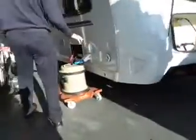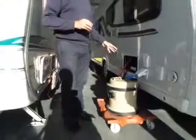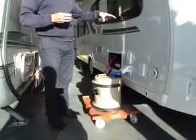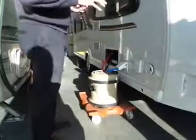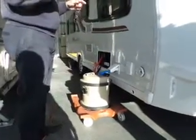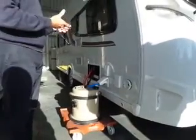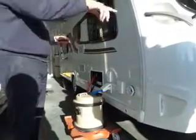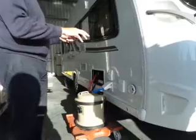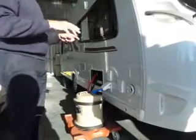So, the next thing you do is you put your Aquaroll on, and you fill it up with water. What you've got with this is central heating in a caravan. The boiler sits there, under the bunk, and it's got two jackets. The outside jacket has antifreeze in it, and the fluid for the heating. It gets heated up, goes round the van, heats the van, comes back to the boiler, gets reheated. In the center of that is a hot water tank of 10 liters. So while the heating's on, it heats your hot water.